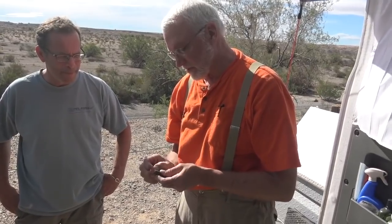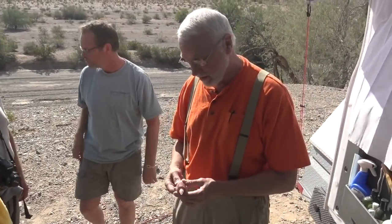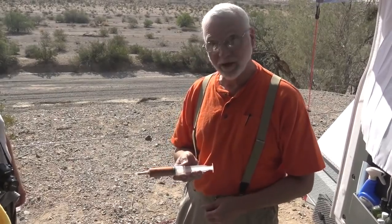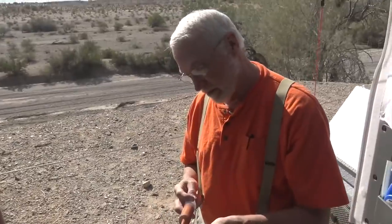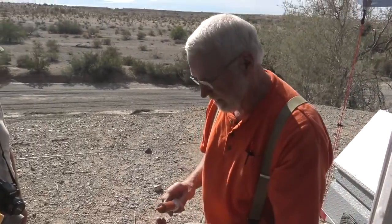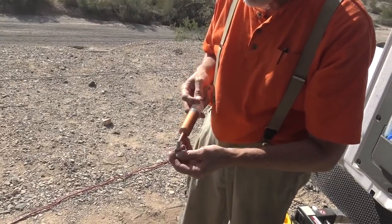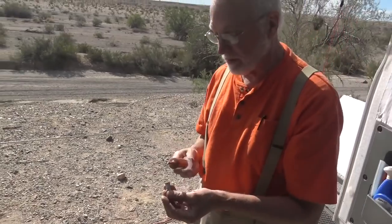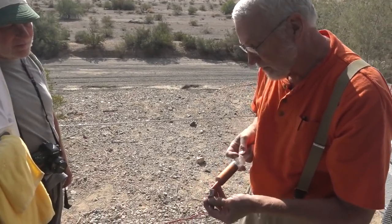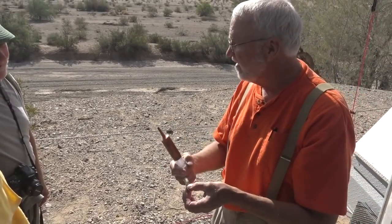You'll see people do this with just an exacto knife — roll it and stuff like that — and sometimes the copper comes off, sometimes it doesn't. This is copper shield, which comes in a jar with a brush, and there's no way to use it without getting goo all over yourself. So I stuck it into an irrigation syringe so I just put a little bit of it in, and that covers it all up, fills the gap. It's copper-loaded anti-corrosion compound — electrically conductive because it's copper loaded.